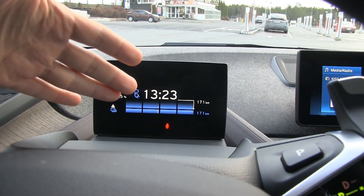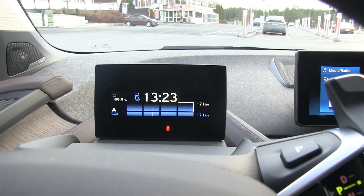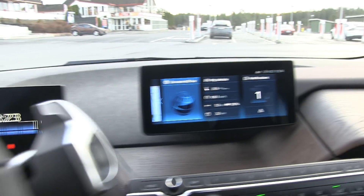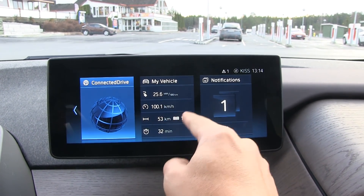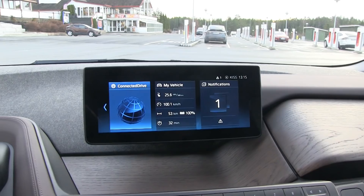The GOM here shows kind of low range — 170km. You're thinking, why shouldn't it be 250km? Well, it has something to do with this, because I really hammered it. Actually it goes down when you're parked, but it was way higher when I came here. So that's why the range estimation is a bit low.